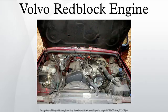The camshaft is driven by a tooth belt that is driven off the front of the crankshaft. The belt turns the intermediate shaft as well, which in turn drives the oil pump, distributor, and the fuel pump of carburetor models. In 1981 the B21FT, a turbocharged B21F, was introduced with a compression ratio of 7.5 to 1 mated with a Garrett T3 turbocharger and a T camshaft.